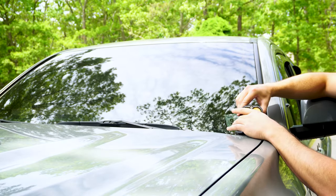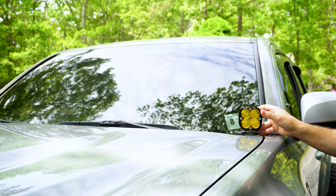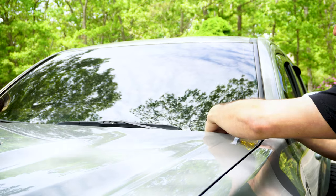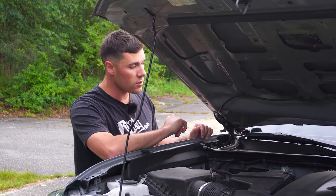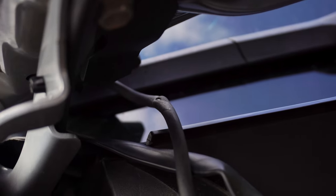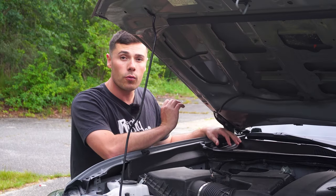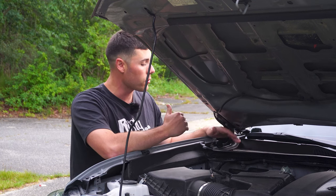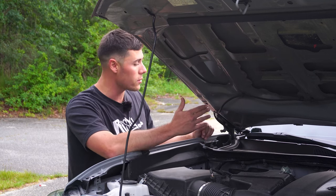Get the lights into the position where you want them — I'm probably going to point them a little out to the side. The wire was being pinched in that last video because it was getting smashed in between the light mount and the weather stripping going across the front of the truck. If you wire it like this, you will ruin the lights — it will cut through the wires. After reworking it a couple of times, I liked how it looked with the wiring going toward the middle, but it doesn't work that way.